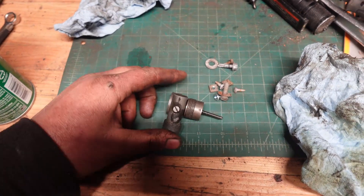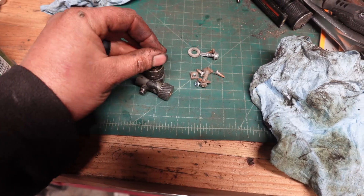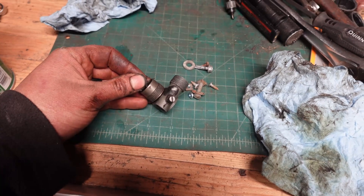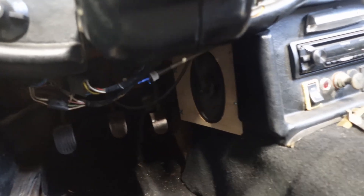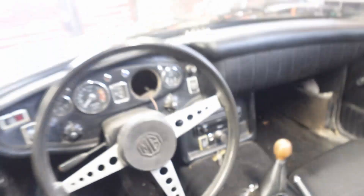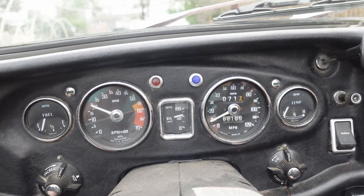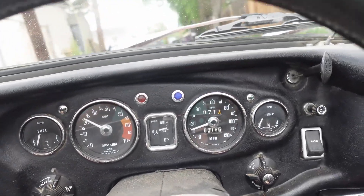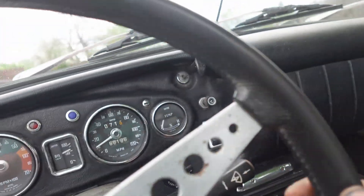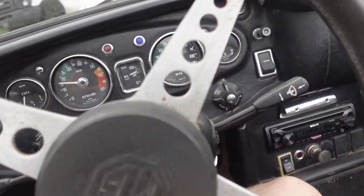Here's what an angle drive should look like when it's not covered in goo. This is the piece that plugs into the transmission — I just cleaned this out and it is spinning nice and smoothly. Turning the wheel now, you can see that little piece of masking tape spinning. So I've got to reinstall that speedometer and she should be good to go. Hey, it's working! It's working!